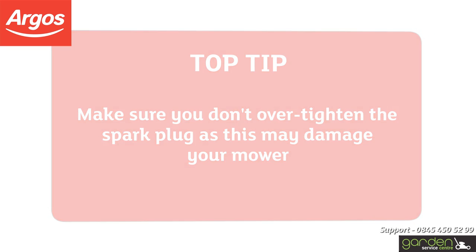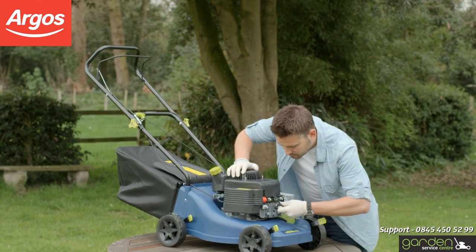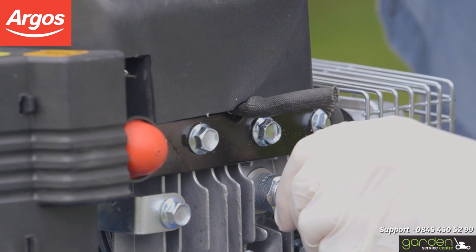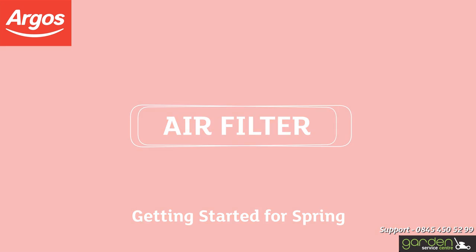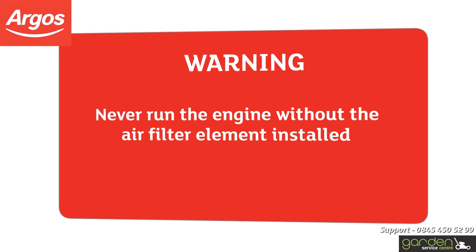Relocate the spark plug cap by lining up the metal contact in the cap with the top of the spark plug. Push and wiggle the cap until it is firmly back in place and feels secure. Warning: never run the engine without the air filter element installed.